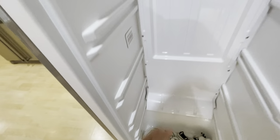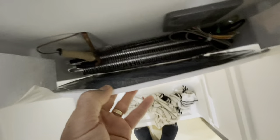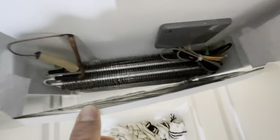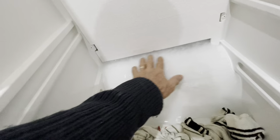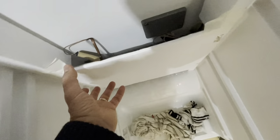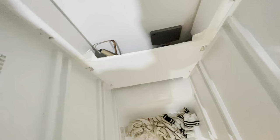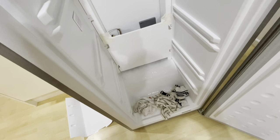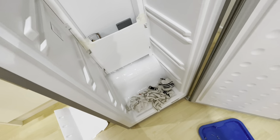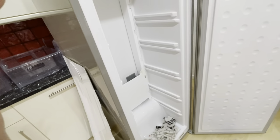So with the back plate off you can see here — I thought there might be pipes here but actually this is the cooling condenser, whatever you call it. It might have been more iced up because this is 12 hours after starting to defrost. You can see this big sheet of ice is going to block the airflow through those cooling pipes and impair how much it can cool. Defrosting and de-icing it is definitely going to make it quite a lot better — let's see if we can save getting a new freezer.